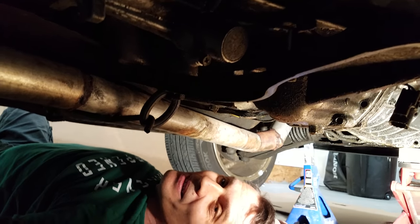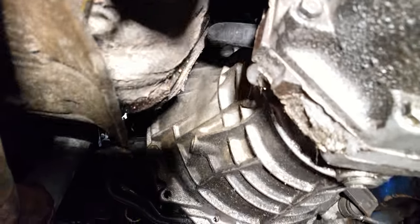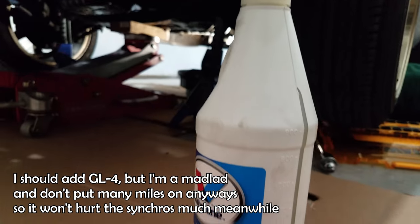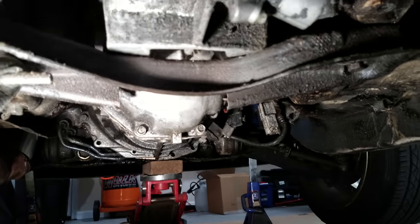I'm going to voice over a little bit because it's kind of awkward to film in front of other people. We checked the transmission fluid — I stuck my finger in the hole and it's pretty dry, didn't get wet at all. We just added some fluid from the top, let it pour down a hose. You can see the underside of the car — not too rusty actually — and also the terribly done exhaust that leaks a bunch and suffocates you while driving. I added some cheap semi-synthetic gear oil, GL5, just to see if it works — about a whole quart.